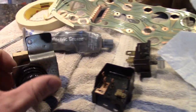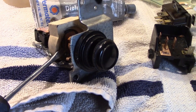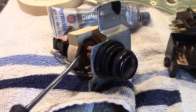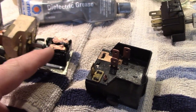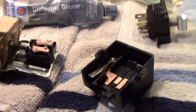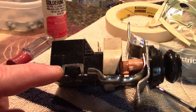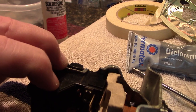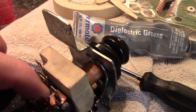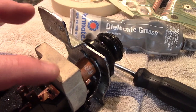To get this switch cleaned up, I basically used my cleaning solution to clean the rheostat and the contact right there — got that really cleaned out. Then I took this box off so I could get to these contacts, and then I applied a little bit of dielectric grease. To put this back together, you just slide the box on; there are these two tabs that get re-pressed, and then on this copper fitting right here there are a couple of tabs that hold onto this prong.